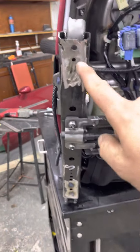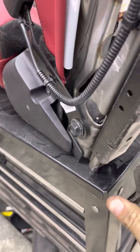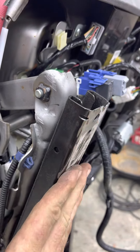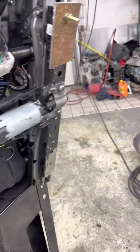These seats have brackets on from the factory — these little brackets here. The brackets were like this on there, so I cut all of the brackets off. This one up front was something like this. I just cut all the brackets off so I got this smooth surface right here, grind it all down, because that's what's going to get welded into the car.